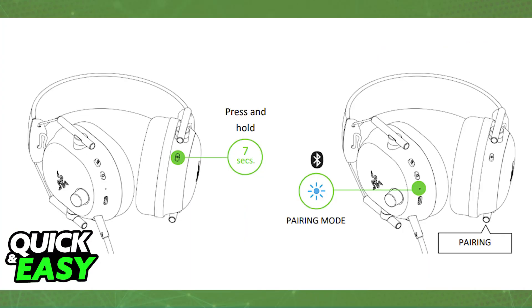For Bluetooth, all that you have to do is ensure that the headset is powered on, and then press and hold the Equalizer or the Razer Smart Switch button for 7 seconds. As you can see, it is this button highlighted here. When you press and hold this specific button for around 7 seconds, you will see a specific LED flash indicating that the headset is now in pairing mode.